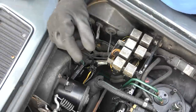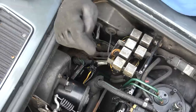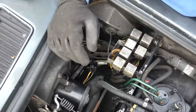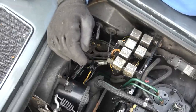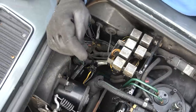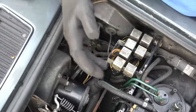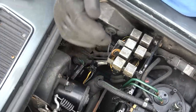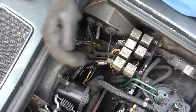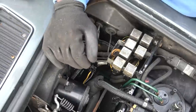end comes up. Right, so I've got it in the bottom. I've taken out the fuse. I've got it in the bottom one of F1, the first fuse, the feeder fuse. What I did is I started the engine, and without the fuse, I checked if the 12 volts was on the top or bottom. The 12 volts was on the top. Weird thing is, when I did the bottom one on continuity test, it wasn't coming up on that circuit board. It was coming up on the top one, but that's supposed to be the feed. And I don't understand what's going on there, unless of course it's fed from elsewhere as well, I don't know.